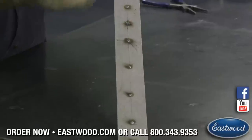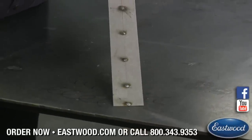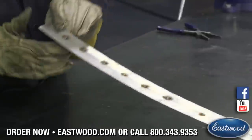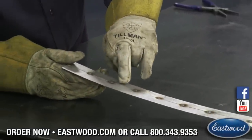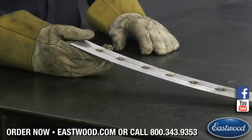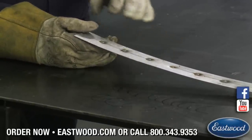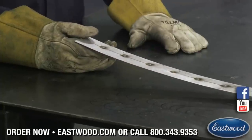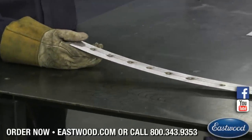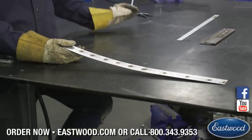Now that our spacing is keeping the piece together so it doesn't start overlapping itself, we're ready to start jumping around on the panel. One thing to remember: keep a hammer and dolly handy so you can adjust any areas that start to act up. This little spot right here — we can see it's not quite flush anymore, it was starting to want to come up over itself. We need to make sure with a hammer and dolly we adjust that area, flatten it out, and make sure it's a smooth seam before we continue.